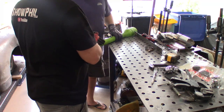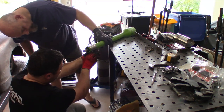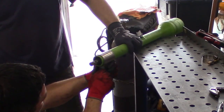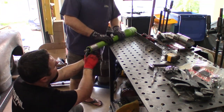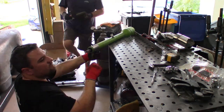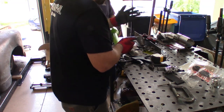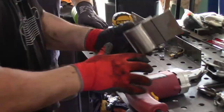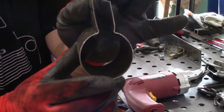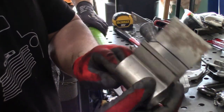We bent this piece of metal just like this — it's going to wrap around the pipe. We can put a nut on one side and a bolt on the other to tighten it right up. This sleeve will get welded into place in the floor of the truck. It doesn't need to be twisting more — like that, it's actually pretty good. The curve looks pretty good. So we'll chop it off at an inch. We built this sleeve that fits around the column with two 3/8-inch bolts, clamping it nicely in place. Now we need to cut off the excess on both sides.